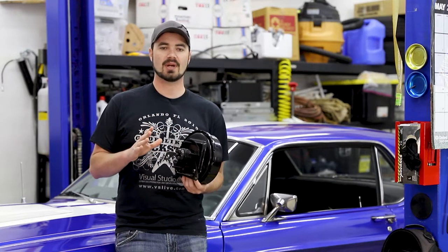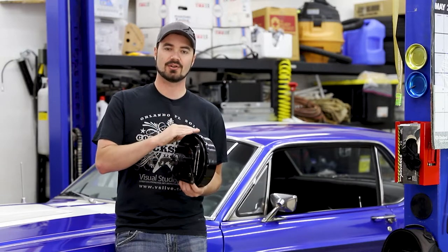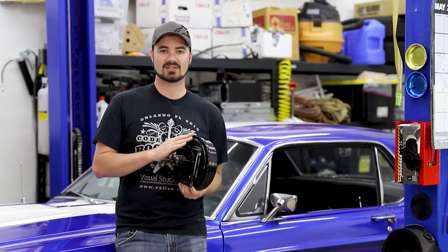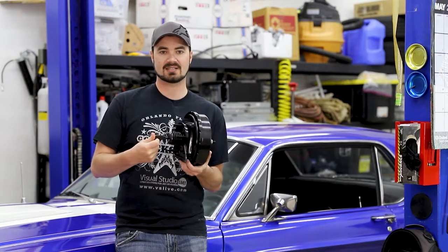The front brake disc conversion kit actually came with a new brake booster unit that matched the master cylinder unit that the kit came with. Unfortunately within a couple months of having installed the kit we ran into problems, namely that we have a vacuum leak around the push rod that connects to the pedal.